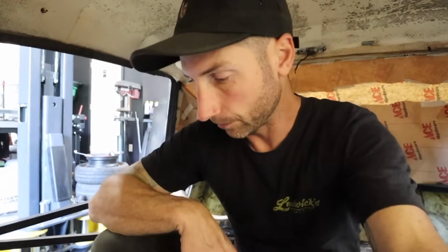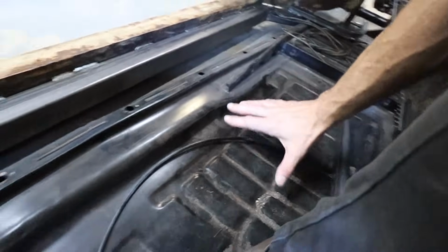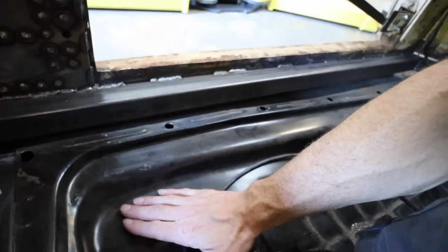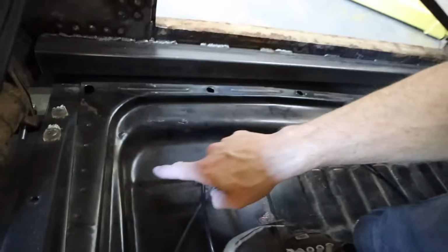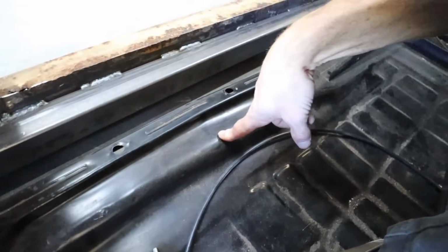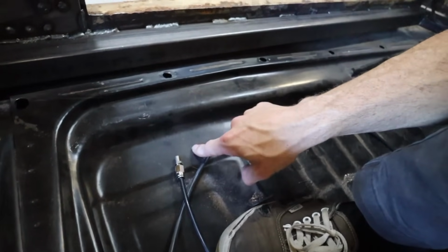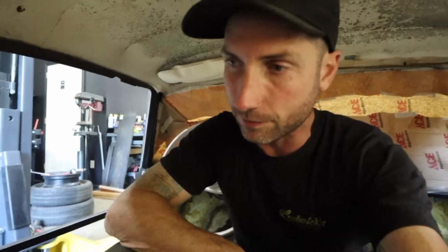We are gonna go lower. And I think that's going to involve having to flat pan the pans, see how the seat tubs and the rear footwells are recessed. A lot of Volkswagen Beetle guys that go super, super low will flat pan this. So you cut this whole section out and ultimately raise it to make it flush with the brim of the actual floor pan. So these aren't touching the ground yet, but we're headed there. I know that to some of you guys, this may seem totally like a waste of time, efforts, and work, but we're kind of frontiersmen on this, and this is the first one. We might as well do it right.